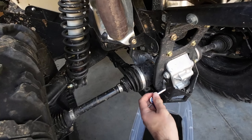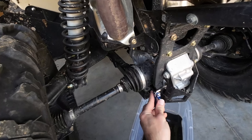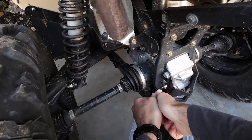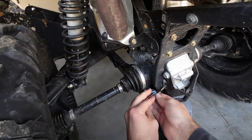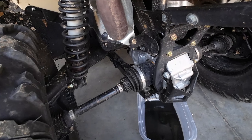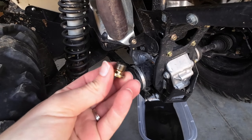I'm at home so I'm kind of limited on tools, and this 6mm is just a hair loose, but we'll see if we can break it loose. It worked. This is the fill plug. It's backing up without the copper washer — the copper washer just fell into the oil. We'll fish it out. That's the fill plug.